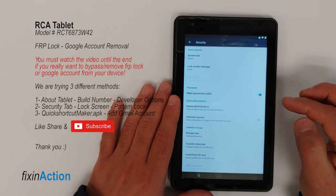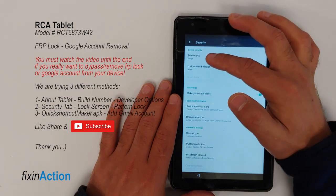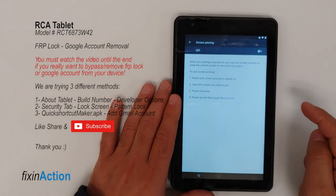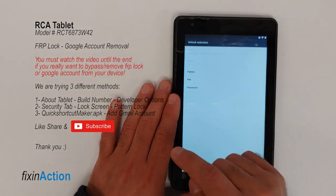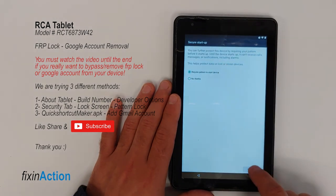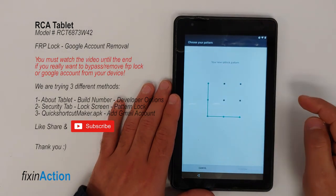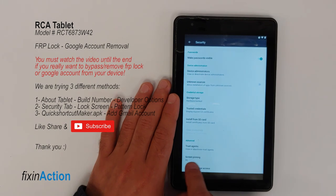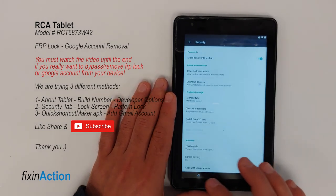Come to Security and set a lock on the device, like a pattern lock or password lock. You'll see 'Screen Lock' and further down 'Screen Pinning' — click on that. Turn on 'Lock device when unpinning,' then check that option. Now under Pattern, require a pattern to start the device. Draw an L pattern and confirm. Now go back and make sure Screen Pinning is on for both options.